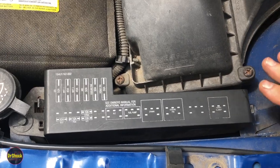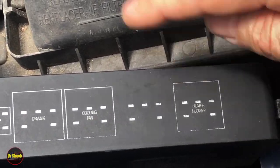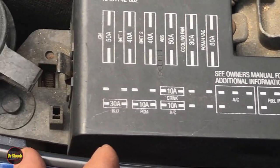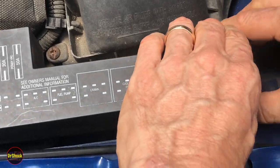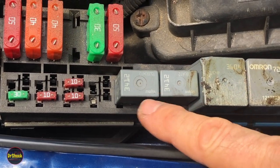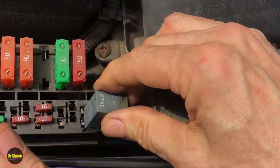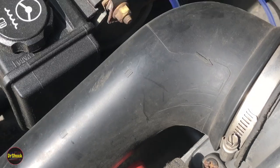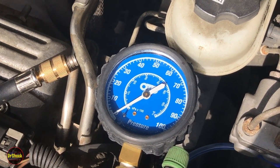Under the driver's side hood area is the secondary fuse panel where the relays are, with the legend printed right on top. We can see the fuel pump relay is right between the AC and the crank. The AC relay and fuel pump relay have the same part number — 3412 — so we swap them to test. We put the fuel pump relay in the AC slot and the AC relay in the fuel pump slot, go back to lamp test mode, and get nothing.